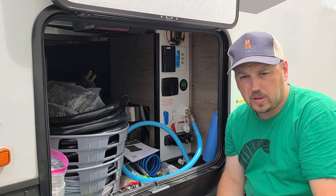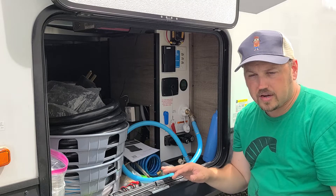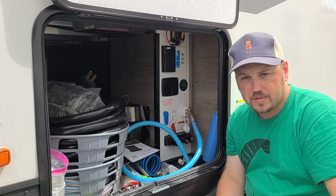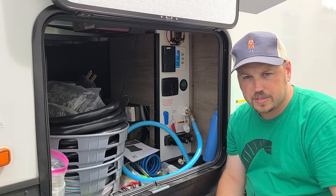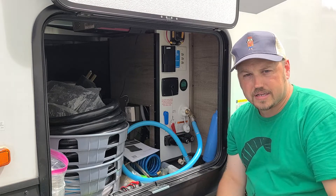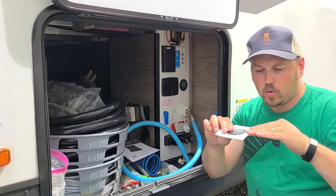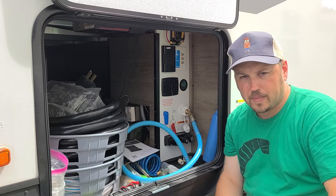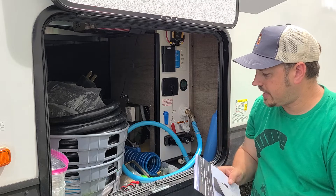If I'm not going to be camping for a long period, I might just shut off the disconnect in the front — that completely stops any load on the battery whatsoever and lets the battery rest. That's also a good time to check your water levels. When checking water levels in your batteries, use distilled water, available at any grocery store for about a dollar a gallon. Fill the water up to about a 16th or an eighth inch just below the top of where the water level is readable — not all the way to the top of the hole — because the battery needs to properly vent and breathe.